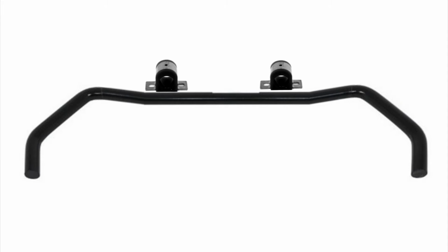Yeah, it did come with the 1.5 inch front sway bar, which is about the same diameter as what we install. Actually, we install 1 5/8 on the older ones. But when they widened out the front track width and the sway bar, they didn't widen the mounting points out for the saddle brackets. This meant the bar was free to bend in a way it wasn't intended to, rather than twist as it was supposed to. As a result, the sway bar didn't work as well, and in many cases, the saddle brackets wound up breaking.